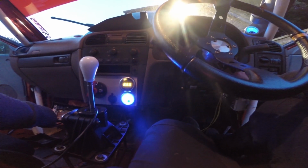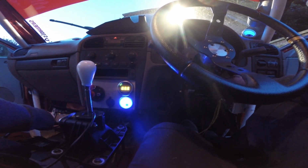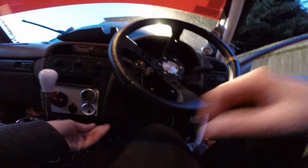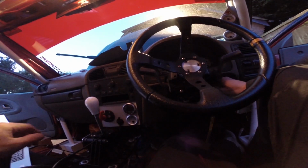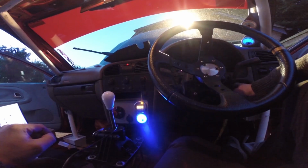No, it's not. No. Let's have a look. When I crank, the injector's now firing. Oh, I know why. I know exactly why. What have you not connected? The strobe isn't strobing, is it? No, because the coils aren't grounded. Right, let's try again. Bang.